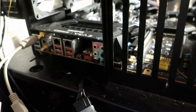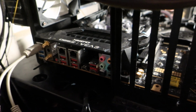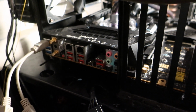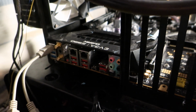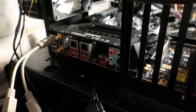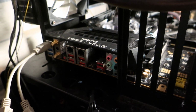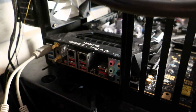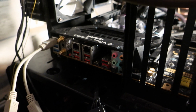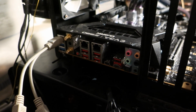You can get some very basic level of functionality for mouse and keyboard when you use PS2 emulation, but that only means very simple, basic functionality for a USB keyboard and mouse. That means you cannot use any mass storage device, so you cannot load anything from a USB key. You have to bear that in mind.